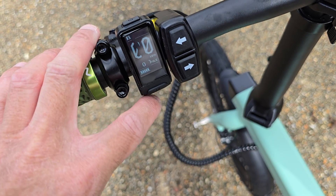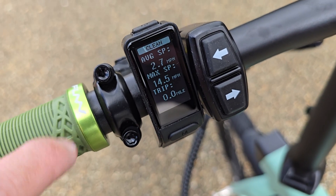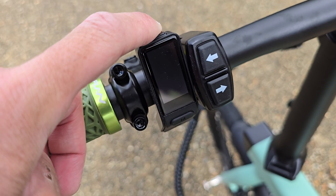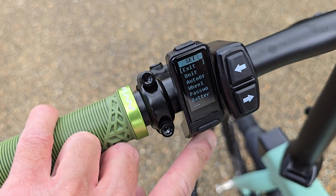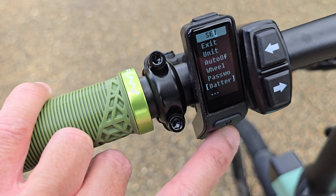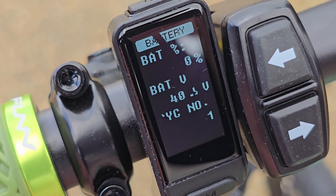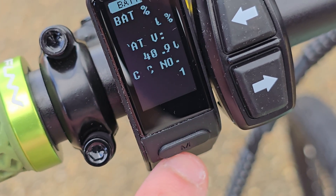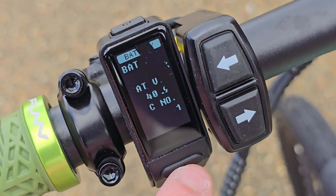There are some modes in the onboard computer. If you long press the set button, you can view statistics of your rides and clear the data. To get into the menus, turn it off first, then turn it back on, and within 10 seconds hold the set button to get to the menu screen where you can customize various options — including changing from MPH to KMH and viewing battery statistics. I can see I've got one charge cycle so far. This battery is rated to around 300 to 500 cycles — I'll double check and put that in the description below.